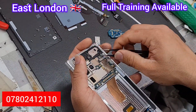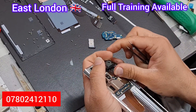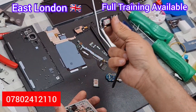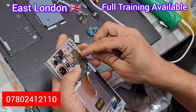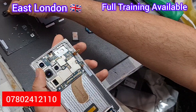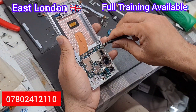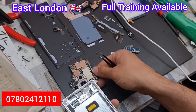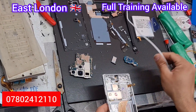Now this is the ear speaker. He forgot a screw and is taking it out now. The ear speaker comes with the vibrator — the red square is the ear speaker and the round thin red film around it is the vibrator. Disconnect the flexes. This is the front camera — disconnect the flex first, then take the camera out. Now take the motherboard out; the cameras are attached to the motherboard. This is the full teardown.